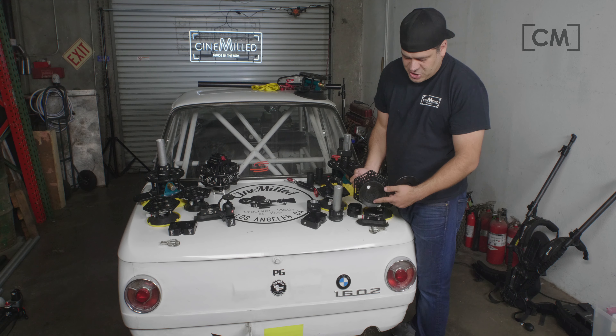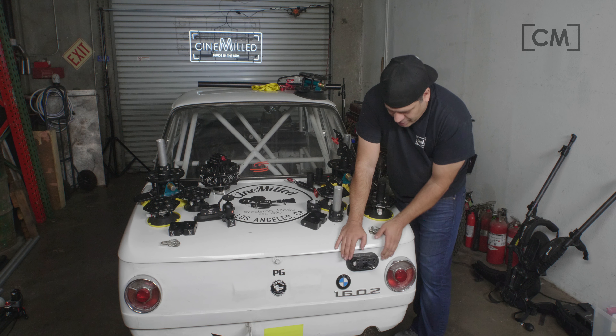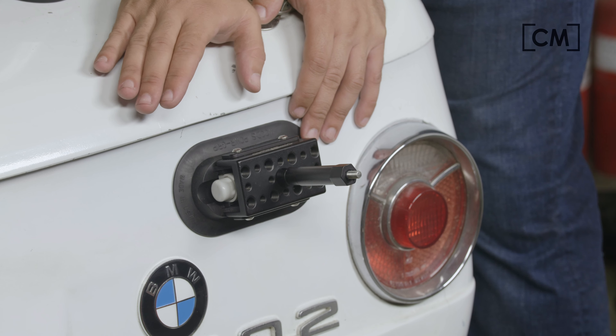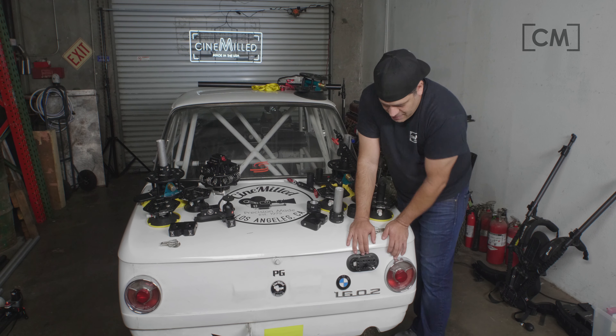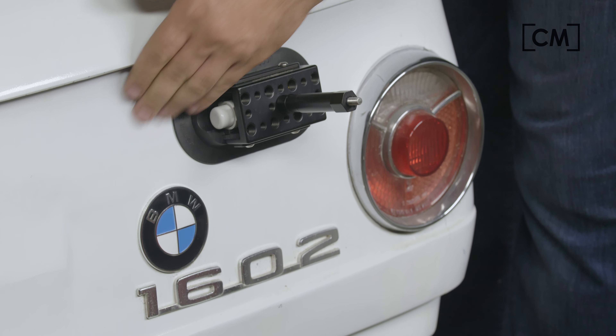This is where the rectangular 6x3 works so great. Because the crease is right there, we can go right above the crease and just apply a little bit of downward pressure. Keep pumping until you see the red line disappear — as always with all Woods Power Grip products, that is the rule. It is possible that after 20 minutes or so, some air pressure leaks out — it's rubber, things can happen, especially the vibration when the car is actually operating. The rule of thumb is, anytime you're not shooting or before you roll the camera, always have a grip or assistant give all suction cups a couple of quick pumps. As you can see here, we got a very strong attachment — you can see we're bending the sheet metal of the car.